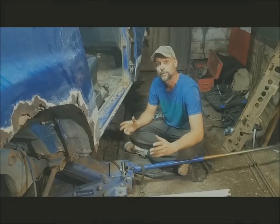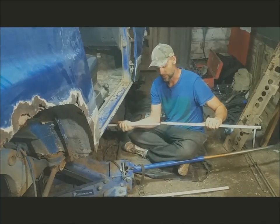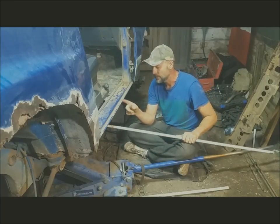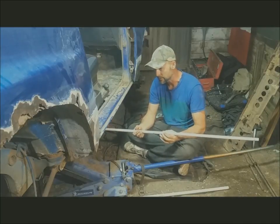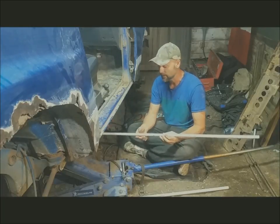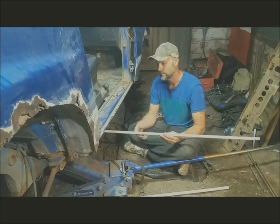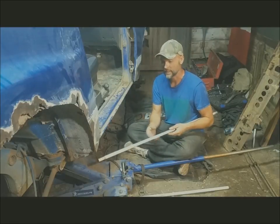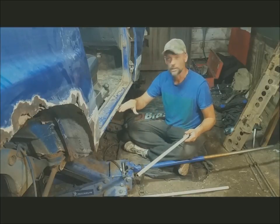For this part I'm going to take some old tent poles that I've accumulated over the years. These are way thicker steel than what was there before, and I'm just going to weld them together, clean it up, and put that across the bottom — kind of like a rock guard or rock slider. This thing is just a mild trail vehicle, so we're not going into full rock sliders, but this is going to be stronger than it was and give me some clearance on the bottom.